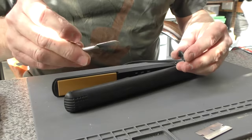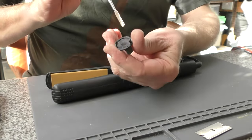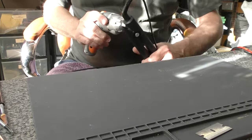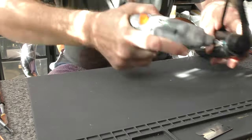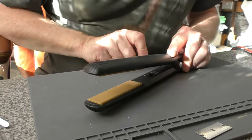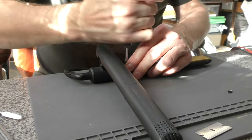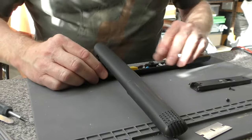We're taking the hinge caps off with just a little flat spudger. Occasionally the little tabs will break, meaning we just have to super glue the covers back on. We're going to take an electric screwdriver — we've got a bit wedged into the work surface — that allows me to easily undo those screws. We'll just push the hinge pin out, separate them, and then take the switch side cover off. The fault is on the other side in this case, but we always check both sides — you don't know what somebody may have done in the past. All looks original.